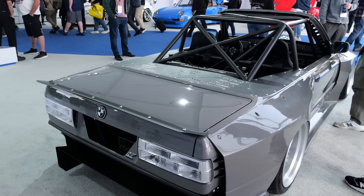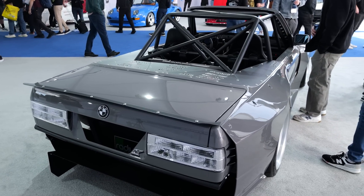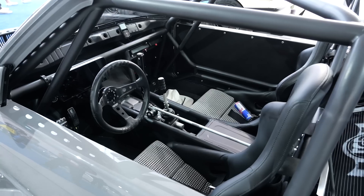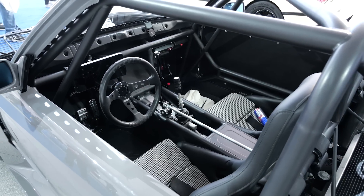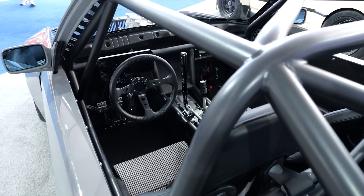The big negative of mild steel is it's not as strong, so it has to be thicker. This car uses 0.095-wall tube on all major sections, whereas the 86 used 0.120-wall. Over the course of a chassis, you're probably saving around 80 to 100 pounds compared to a 350-pound tube chassis — that definitely adds up.